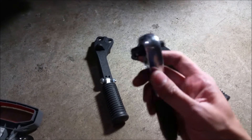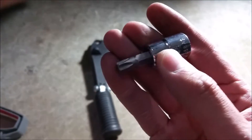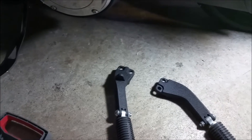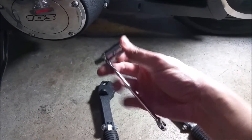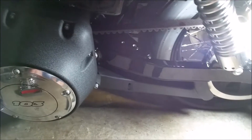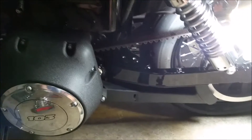Even my stubby wrench didn't fit. What I did was — thankfully this Torx bit had an Allen body to it — so I just put that on a socket on a box wrench. It took me a long time, like 10 minutes per bolt. I had to use a breaker bar, basically just any metal rod, to have leverage to break it loose so I could start doing it by hand.